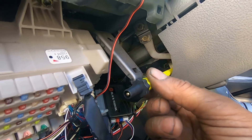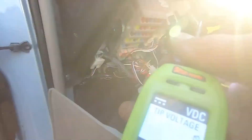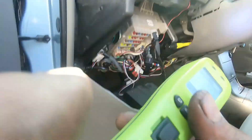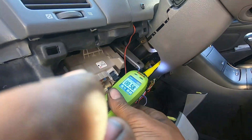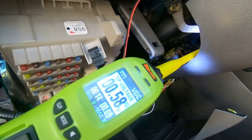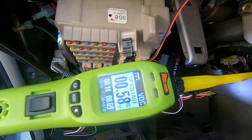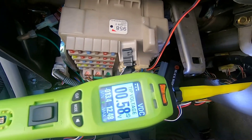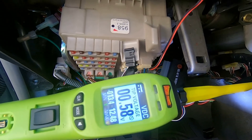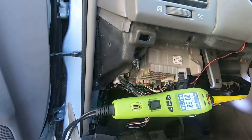I got my pinch tool connected to the black and white wire. I'm going to pull that off — I should be able to plug up with my power probe right to there. Now you can see my voltage. If this goes up to 12 volts, we know it's not an ignition switch problem. There it is — 12 volts. Turning the key now.